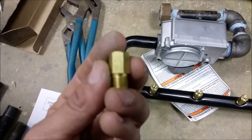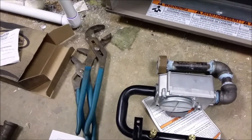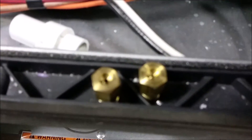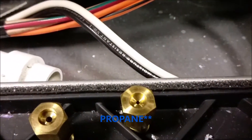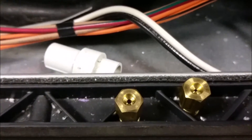It all depends on where you live and the type of unit you're using. When I say where you live, it means how high above sea level you are, because gas pressure and combustion change with atmospheric pressure. Here you can see the difference between the two orifices — the propane orifice is a lot smaller than the gas one. That's why we gotta change the nozzles — if you left the gas orifice in and used propane, you'd have a really bad day from too much combustion.